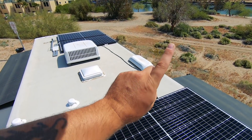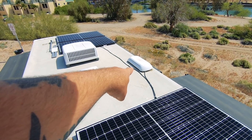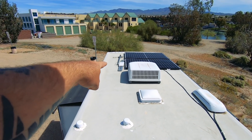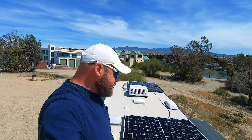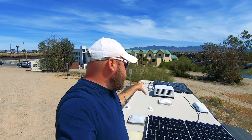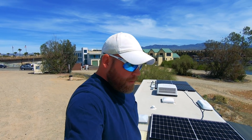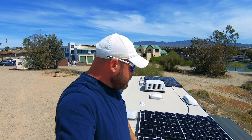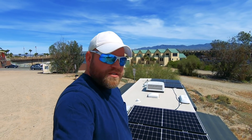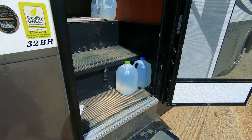All the wiring is zip-tied and sealed on the roof, and we ran the wires in through the refrigerator vent so we didn't drill any extra holes. The two front panels have enough clearance for my antenna and my batwing TV antenna. You don't want to mix and match panel sizes — stay within about 10 to 15 percent of the same wattage if they're going to the same charge controller. I clean the panels about once a week, and they were pulling 90 volts DC going down into the charge controller.